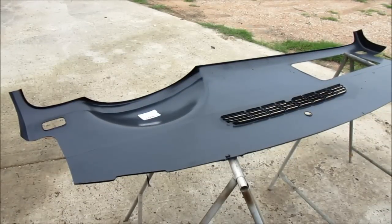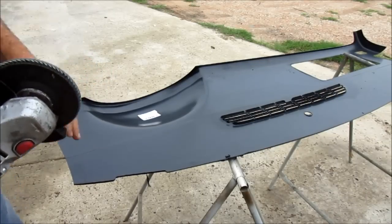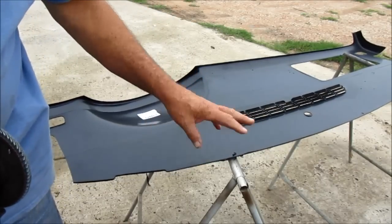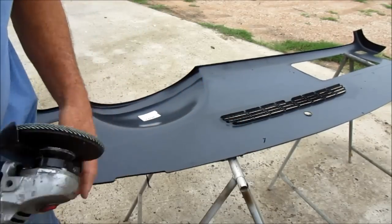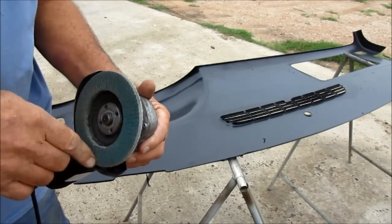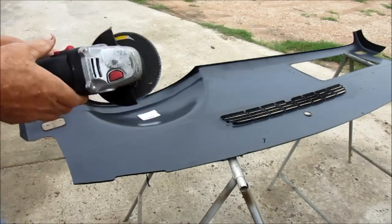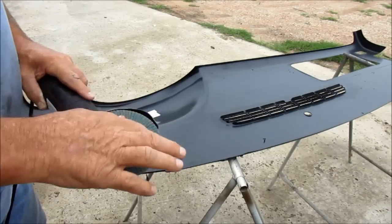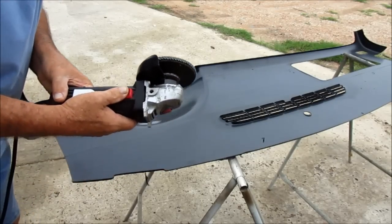There's some background noise on the road, but there's not much I can do about that. I wanted to get into the picture on this part here: this little lip — sometimes on some of the 2007s and 2008s — for some reason there's a rubber gasket on the front of the dash and this may not sit down well. We can't change the way the dash is designed, but we can come in with what they call a paddle wheel on a grinder — or you can use a utility knife or anything similar. This is what we use: an old cheap Harbor Freight grinder with a sanding pad, and we just take some of this off. I'll run through part of it right now to show you how to resolve that problem.